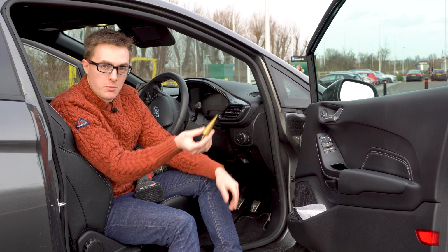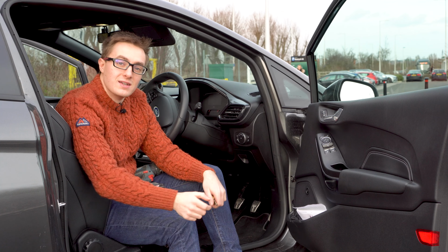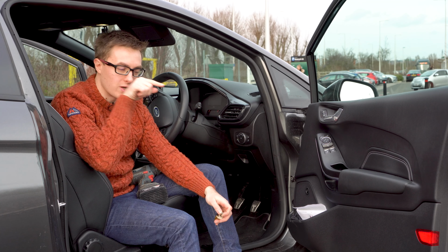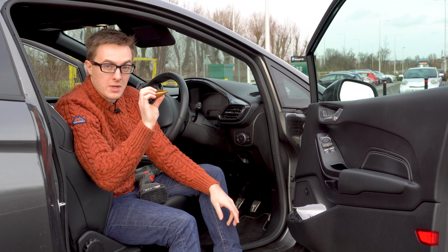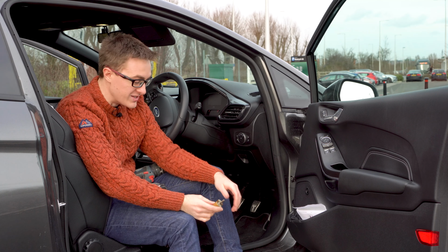But the advantage of using a Christmas tree drill bit is that you can go as deep as you like without having that stabbing effect. So if you take a normal drill bit, as soon as you go through that plastic, you're going to get a stab in the other side, and if you've got something important on the other side, not a good idea. But with a Christmas tree drill bit, you simply go in as far as you need, and then there's no stab at the end.